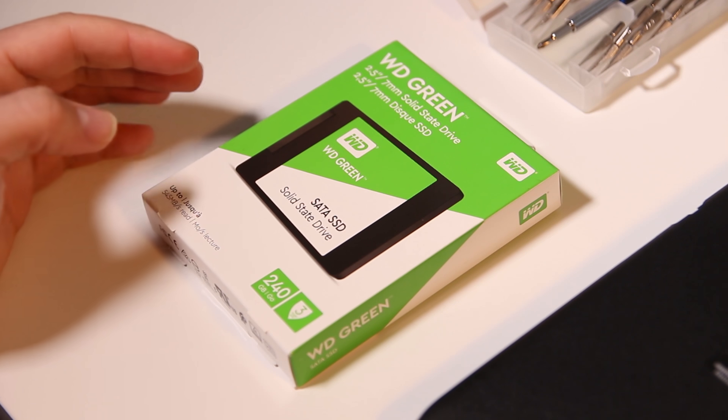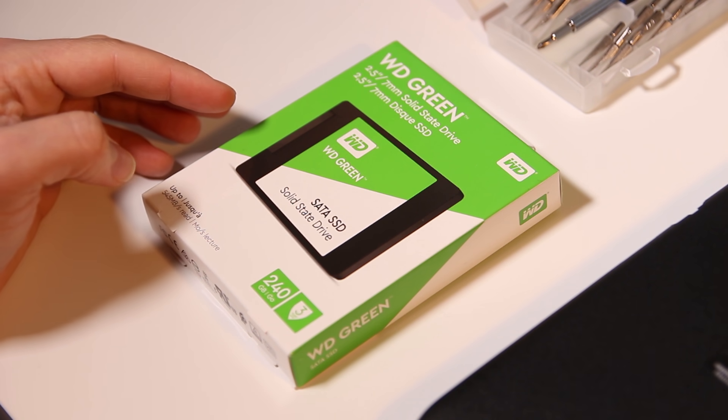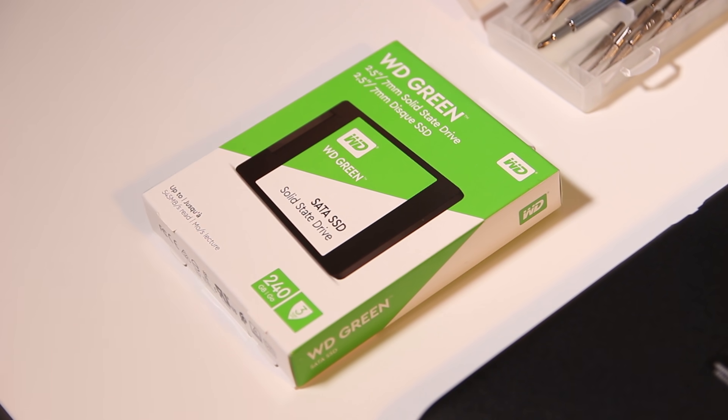First, let's see what you're going to need. Obviously you'll need to buy an SSD, so pick one from a reputable brand such as SanDisk, WD or Kingston. Buy one with enough capacity for your needs. I'm going to be fitting an SSD with 240GB, because the owner is storing reasonable amounts of data but not massive amounts of photos, music or videos. If you're not sure what capacity you'll need, have a look at the label of the hard drive you'll be removing — it should have the capacity printed on it, and if that hard drive was enough for your needs, buy an SSD with a similar capacity.